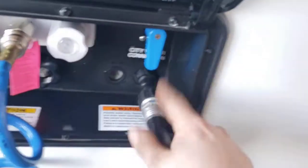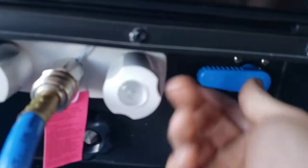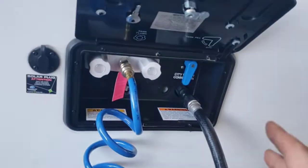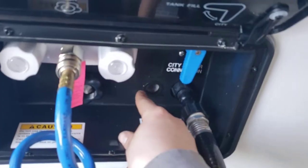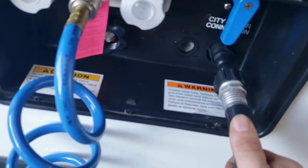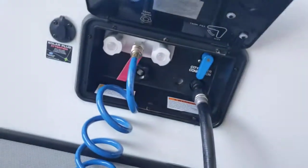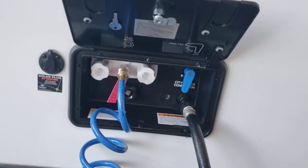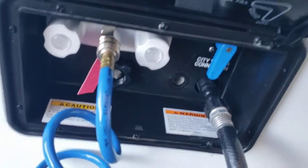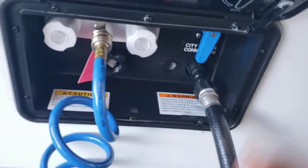Here you have water input for city water. Pin it this way and it's going to fill your onboard fresh tank — when you start seeing water squirt out, your fresh tank is full, but monitor its progress from the inside and don't let it get to that point. You also have a black tank flush. Move your hose from city water to here only when you're dumping your black tank. After the black tank is dumped, move the hose there and turn it on to flush it out, because sometimes it will fill faster than it can dump and you don't want anything coming out your toilet.